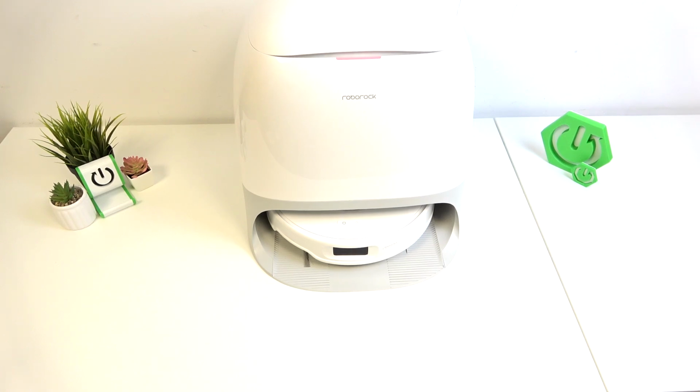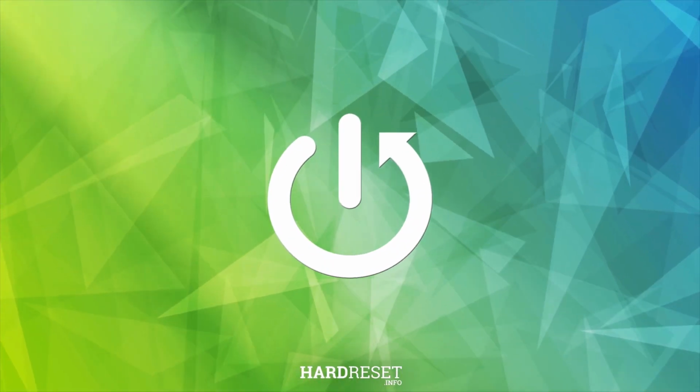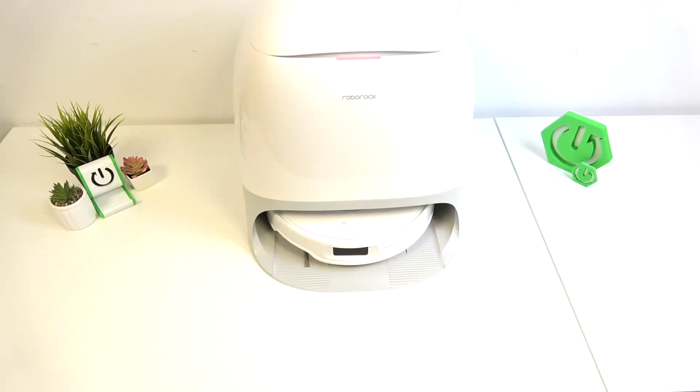Hello, in front of me I've got ROBOROCK Qrevo. In this video I'll tell you what things you should clean on your automatic robot to maintain proper functioning. In the beginning you have to clean main brushes every 2 weeks and replace them every 6 to 12 months.